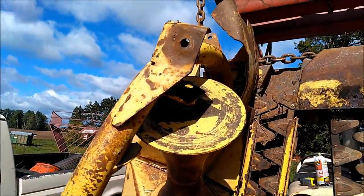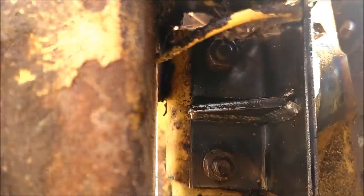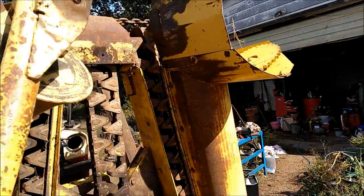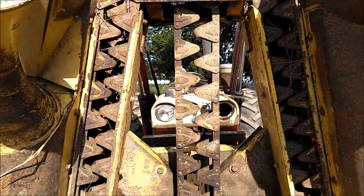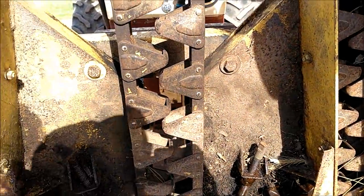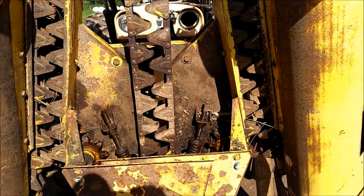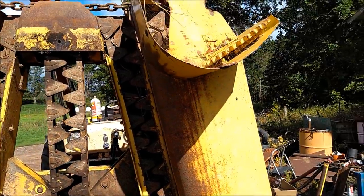I got the first one of these on here. Went on good — bolted right on nice. Got it bolted on there in the back. Fit good, so that's good. Now I'm just going to get the other one on and then put the cross one on that holds them together. Also I pulled the tin off the middle of these adjusters — this one here was stuck, the spring was all caked up. So I pulled this off, getting them all lubed up, and getting those adjusted like they should be as long as I've got it here. Now we'll get going on the other one.